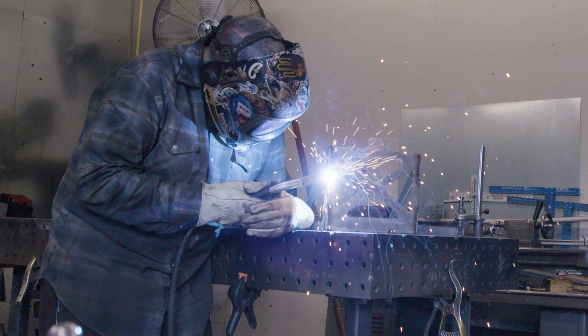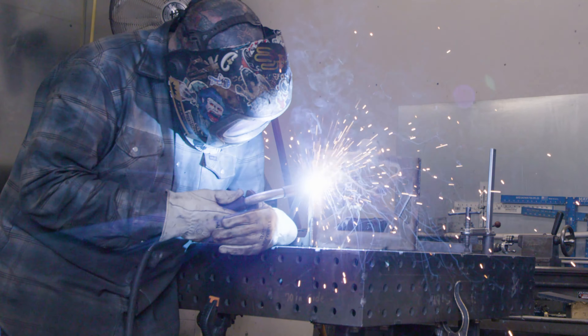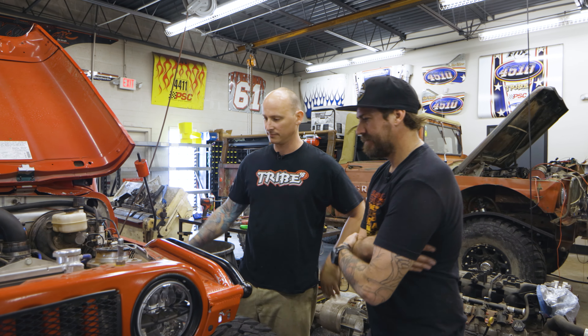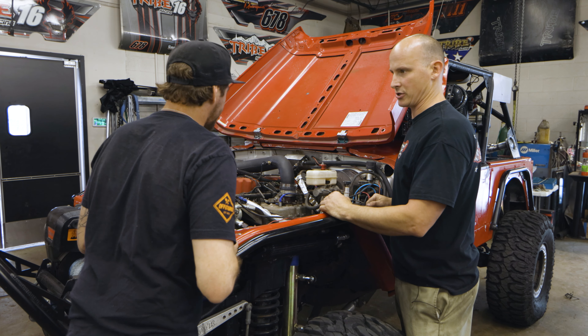We actually machine some of the fittings to make them flow better, less restrictive, and produce less heat. The small things really add up and make the systems survive and perform a lot better. On a mid-engine car, if something can't be reclaimed we try to take it out the very back of the car — if something gets hot and starts leaking transmission fluid or whatever, it's going to go out the back and not catch on fire. If you roll over in a weird spot and it auto-drains, it's not going to drain all over your engine or exhaust; the mess will be out back.